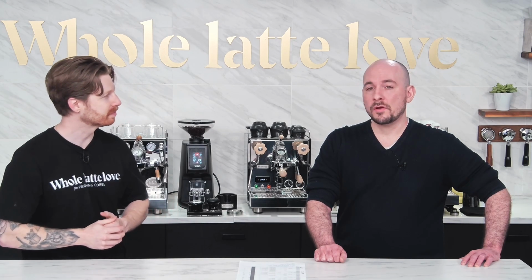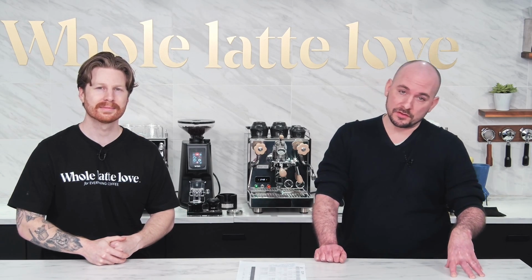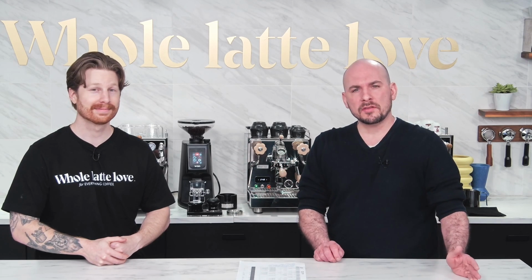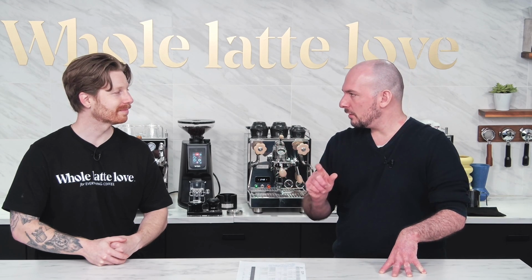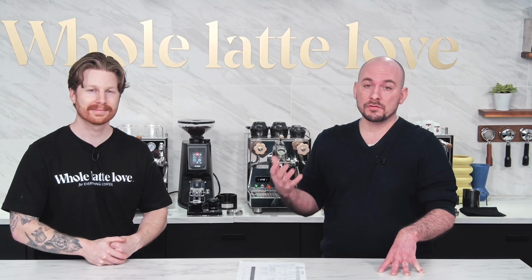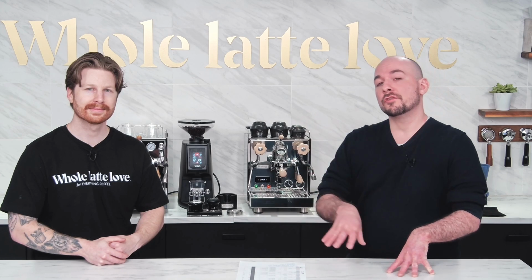Right, exactly. So, what you may see, especially if you wind up picking yourself up one of the press sensors, the Bluetooth pressure sensor that Zach has talked a little bit more at length about in a review video that we've done on those, is that initial pressure in the flow will be a little bit lower before reaching that maximum output. And then if you're using a flow control device, the stock flow rate is actually going to be lower on a vibratory pump machine versus a rotary pump because it's just not moving that water as quickly.